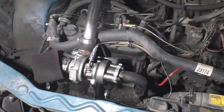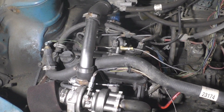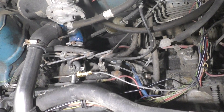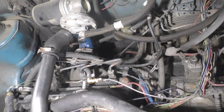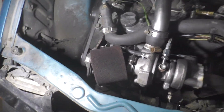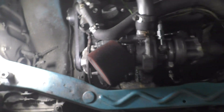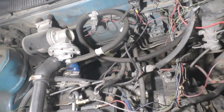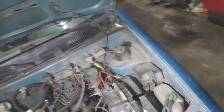Got the high-pressure oil line ran down to the T, oil return going there. Picked up a flange off eBay and I just gotta get this tube cut to the right spot to go down and meet up with the exhaust that was there before. I'm curious if I'll have enough room for the alternator to sit in there with the turbo - we'll see what happens. It also seems like it sticks up a bit higher so we'll see if it clears the hood. Got the line for the boost gauge hooked up, just hooked it to a manifold port that used to come off the crankcase ventilation. I'm gonna take the crankcase ventilation and run it over into the air filter.